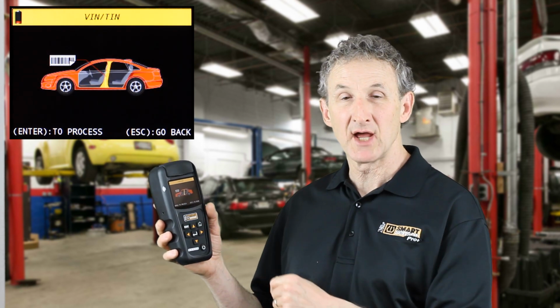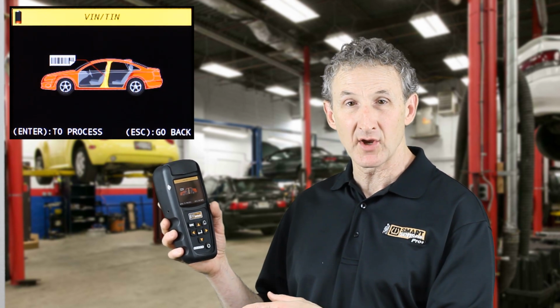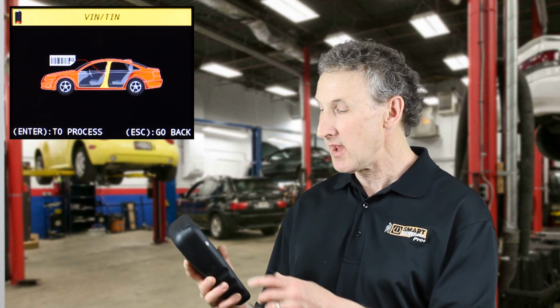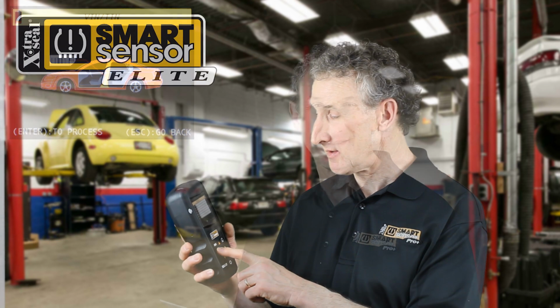The tool will tell you that the barcode on that particular vehicle is located on the B pillar of the car. You can simply go up to the B pillar, scan the VIN code, and it'll populate right on the tool. Then you can save it in history.